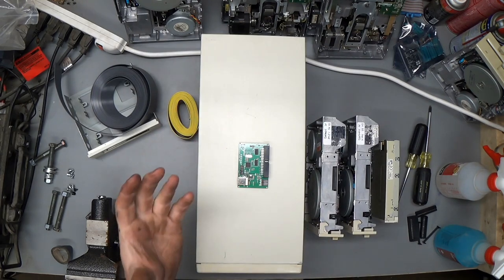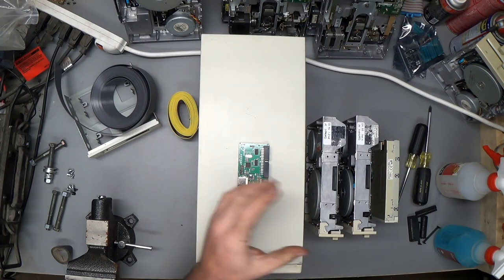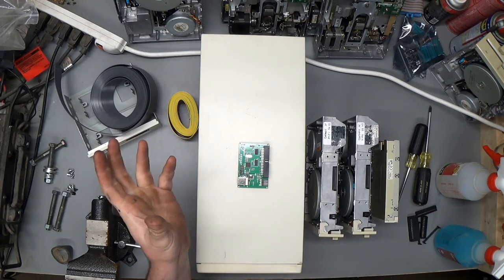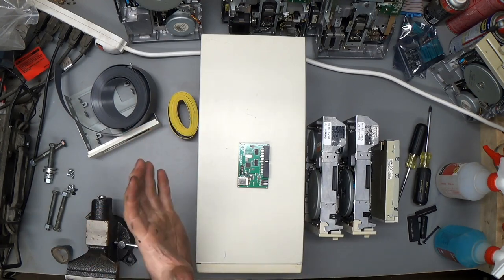It's not a regular floppy controller though. You can't mount them as file systems or anything like that. Well, you could if you wrote a driver, but it would probably be kind of slow, because these things are specifically made for flux imaging — reading the raw magnetic transitions off of the magnetic media, regardless of the disk format. So theoretically you can write GCR-encoded disks with a PC MFM floppy drive, because flux is flux.